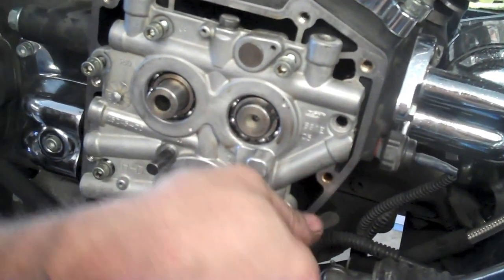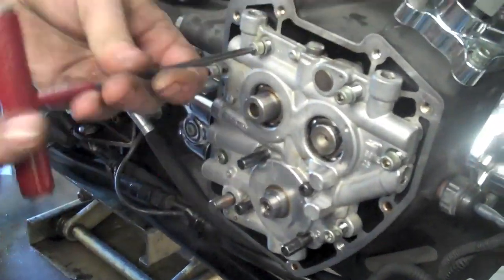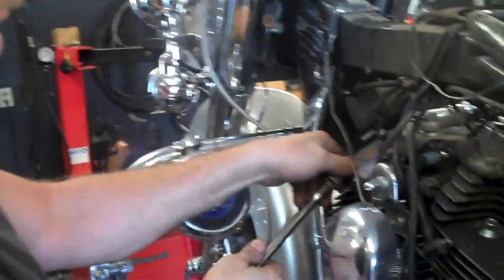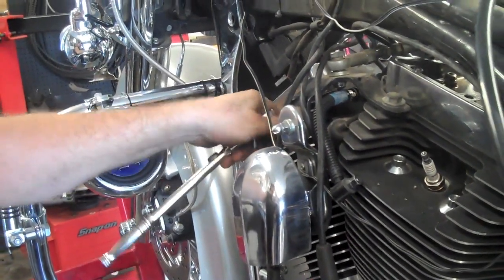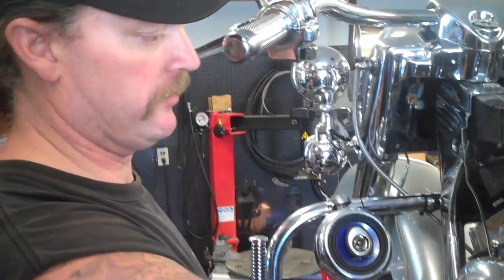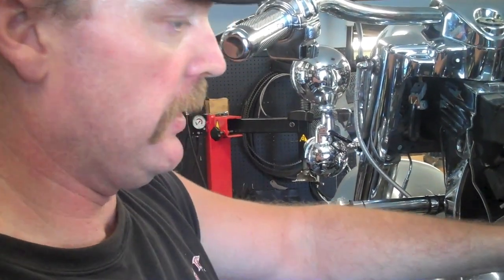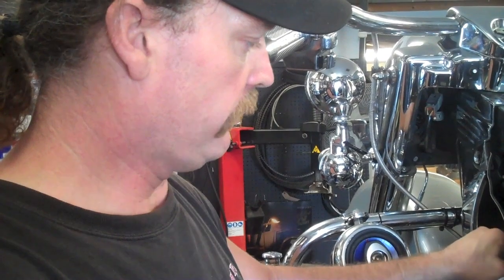What I'm going to do is basically lock this plate down, and then I'll show you how to center up an oil pump in a twin cam. Before tightening my oil pump down, I just tighten the plate. I remove the plug so I don't have cylinder pressure holding me back so that I can spin the motor. I do this a little unorthodox because sometimes we don't have two people to help out. I leave my battery on and set the dashboard and road keys to the side so that I can turn the power back on the bike and use the starter to rotate the motor and center my oil pump.